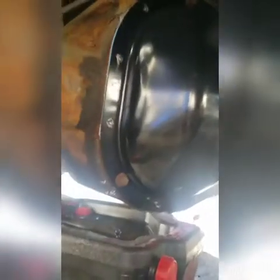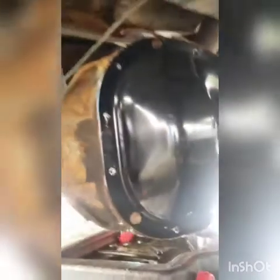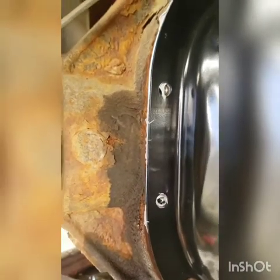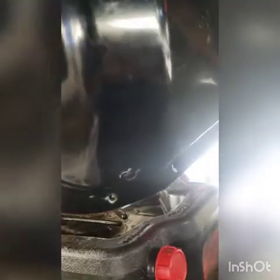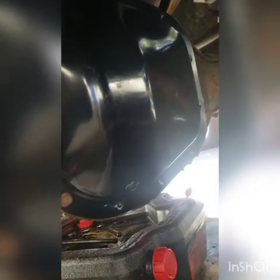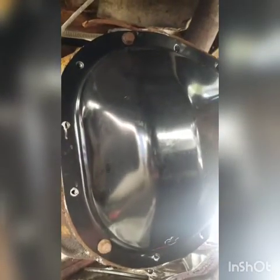Here we go. I got a bolt on the bottom there, bolt on the top. I'm going to give that RTV a chance to tack up before I crank it down, because I stuck it mostly to the outside of the diff cover and you don't want to get any inside - that's no bueno. We'll go through and clean up the bolt holes where the RTV squirted out, and then we'll crank it down. Obviously when we crank it down in the next pattern you don't want to over-tighten. I'll probably go kill a couple hours mowing grass or something and come back out here and crank it down some more.